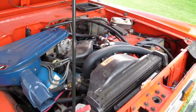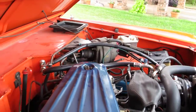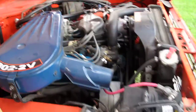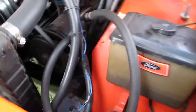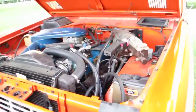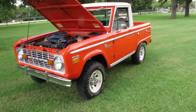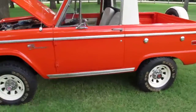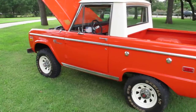It's got the original air cleaner, upgraded to power brakes when they did the Dana 44 front end, so it's power disc brakes. That's your power steering cooler, and of course the power steering box. The original Broncos — the '70s — most of them had a Dana 30 front end with manual steering. Some of them were six cylinders, some of them were V8s. But she's a pretty truck.